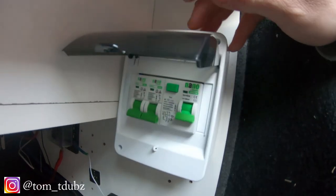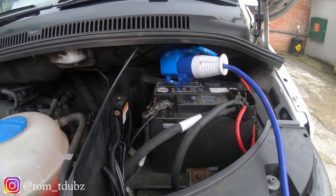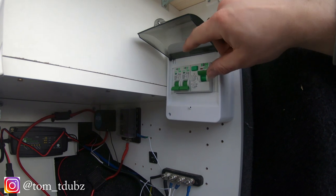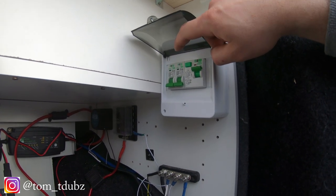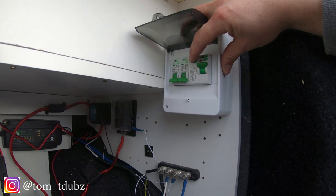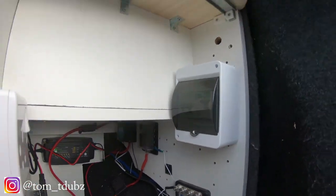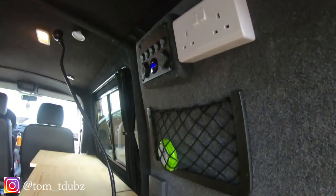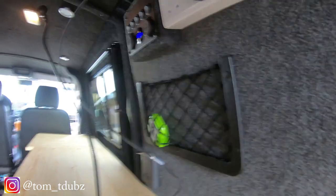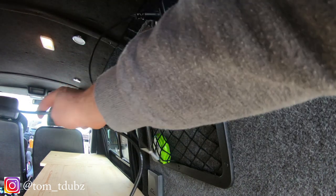The box fascia is still on - let's plug her in and see what happens. That's the cable hooked up. I've closed the bonnet over a bit. I've switched the main supply on - it's currently fed from the house on one of those little extension plugs. I should be able to push this to test it and it should turn itself off, which means we have power. I'm going to turn both switches on, then go up into the van and plug my light in just up there, and then switch it on - and hopefully we have power!